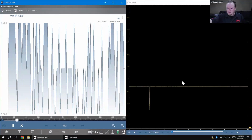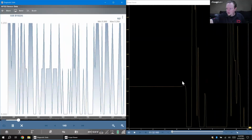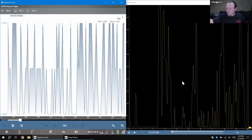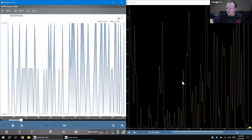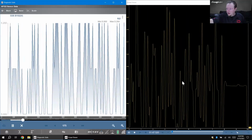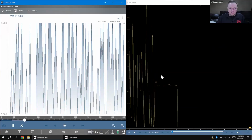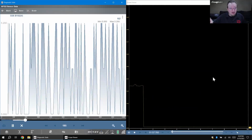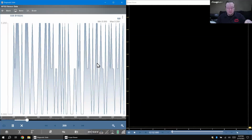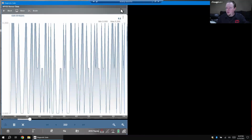However, if I'm over here before it gets into the car or before it gets into the computer, and I'm seeing the ups and downs and all arounds, just like I'm seeing on the left side, and this is hard to do with a knob, but you kind of get the gist, right? If they look like they're doing the same, voltage ranges are doing the same, then you're probably okay. And if I got this flat line at 0, then yeah, that's not good either. So that is our going in on the right-hand side and going out on the left-hand side. So front door, back door, and we can do it on the same screen if we want. So that is scanner versus scope.